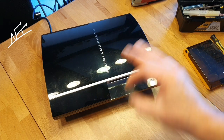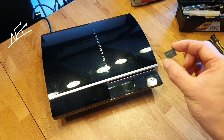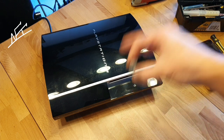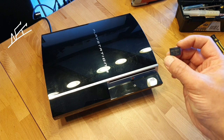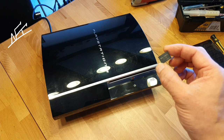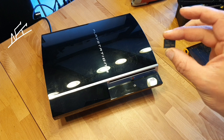We're gonna open this, replace the bad capacitor with this original one that is still working, and then we will have proof to see if this test was okay or not — if the PlayStation is working already or not. Then we will be able to install some great Tantal capacitors as I have shown on my other videos. But this will be just a video to see if this will work after we replace this good one here.